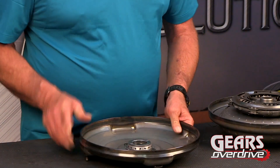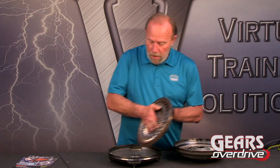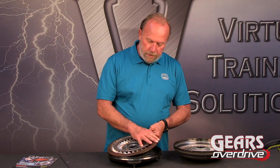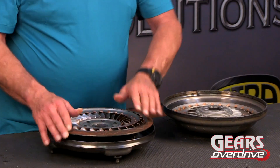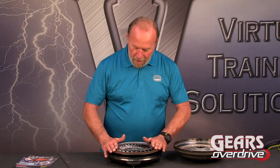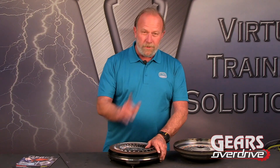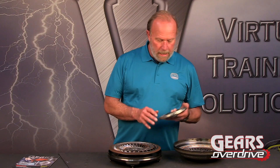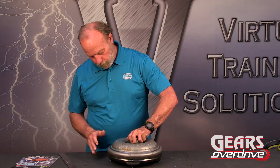So that's the cover and the stator. This is going to present a challenge for all you torque converter rebuilding guys, because of the way that the clutch lining is mounted to this flat surface. They're going to have to come up with a way to put the pressure on it, because that pressure has got to be square to that kind of an angle. So that's something for the torque converter rebuilding industry to tackle — makes it very interesting. So that's the 10R80 10-speed, and that's a look at the torque converter. My name's Bill Brayton — thank you for watching Gears Overdrive.